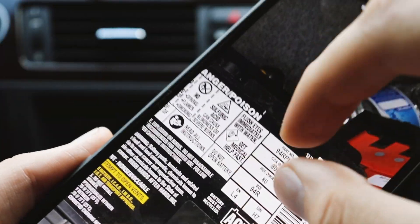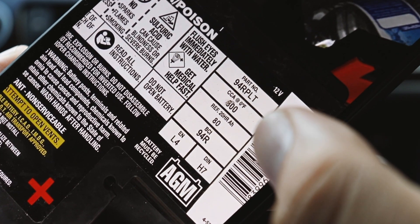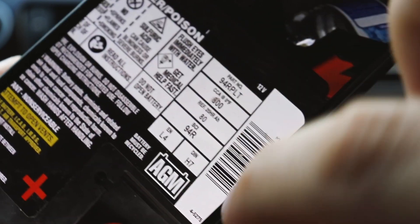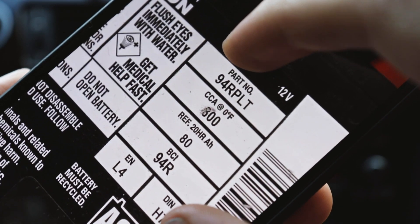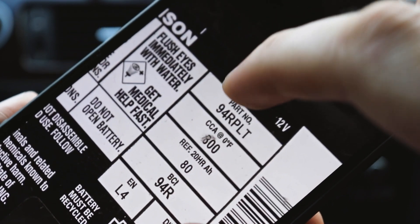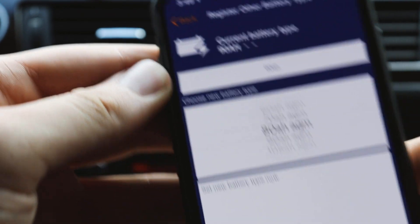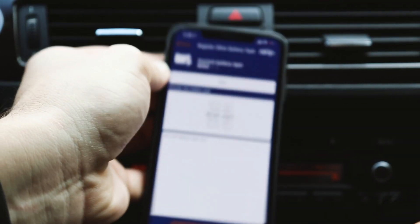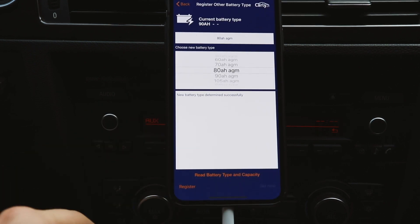I have a picture of my battery. It says 80-80 right here, and then it says AH. I don't know anything about batteries, but I'm assuming that means 80-AH and that this is an AGM battery — so 80-AH AGM. That's just going to be my intuitiveness, so cross my fingers I'm right. I'm going to go ahead and hit Set Now to change the battery type. It was changed successfully — I'm going to hit OK.